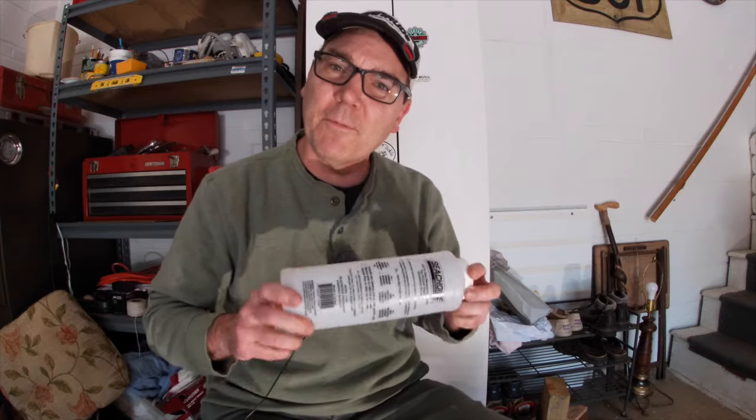Also, you want to be sure to use the right oil for your outboard engine. Do not use 10W30 or 0W20 automotive oil. TCW3 grade oil is the right kind you should be using for your outboard engine. Some people go with specific name brands, others use whatever they can get off the shelf. And here's the most important piece of the puzzle.